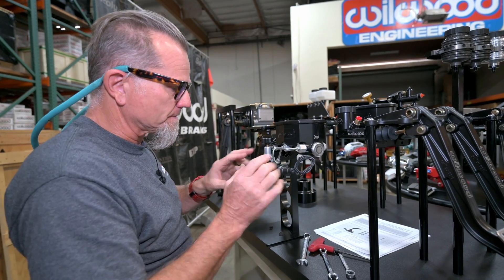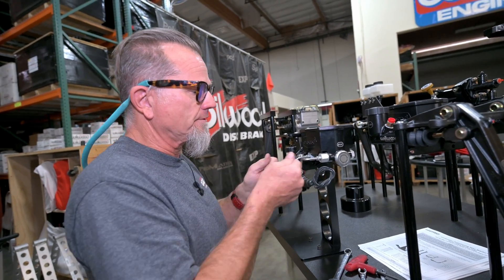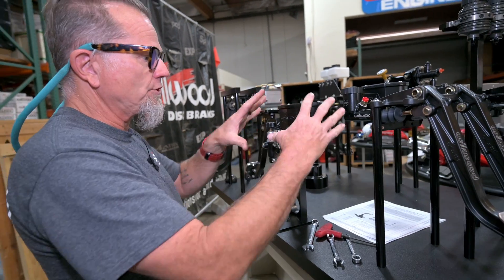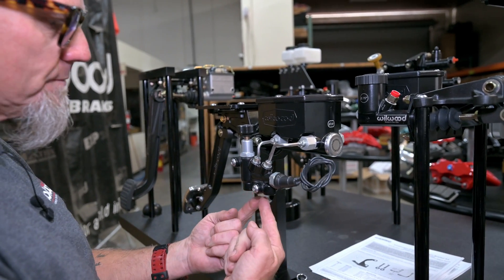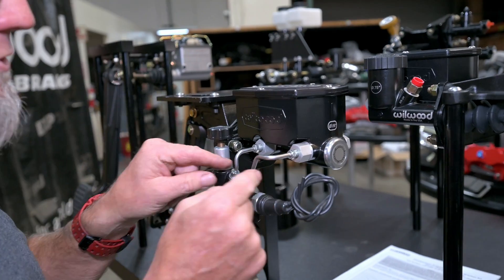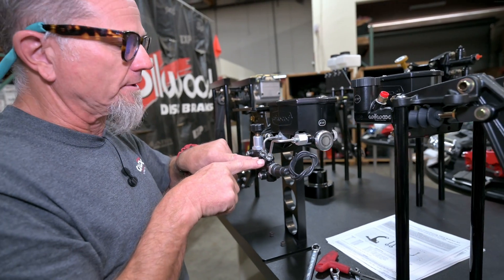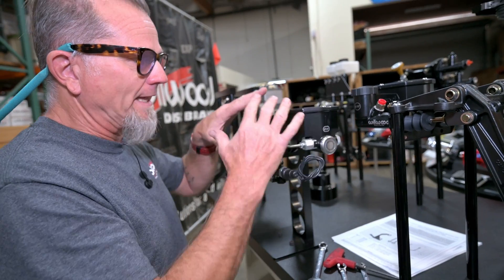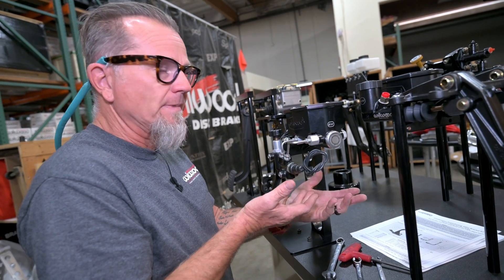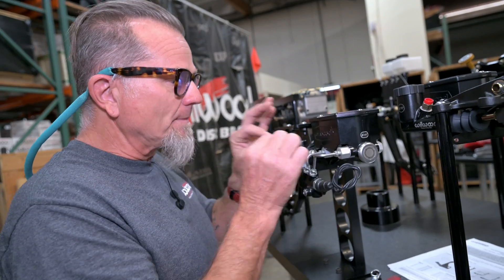At that point I am 100% sure this is going to be fine. Another problem I think people have is they don't do the mock-up — they go straight into bench bleeding, then mount their master cylinder or prop valve onto the master cylinder. Don't do that. Get this dry mounted in the vehicle and get all of your lines run so everything is ready. Then you can either take the whole unit off and bench bleed it — you can come straight out of these lines into the master cylinder — or loosen the tube nuts, then loosen the proportioning valve bolts in that order. Don't try to, after you bench bleed the master cylinder and put it back on, install the tube nuts with the nuts down into the proportioning valve tight — you'll never get them started. If you loosen things after bench bleeding it will leak, but just wad some old towels below the assembly. Because you already dry fit everything you know it's going to go back together, so you won't lose too much fluid.